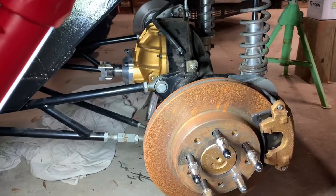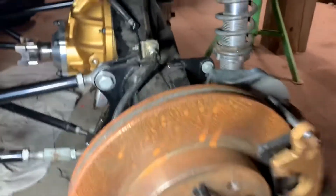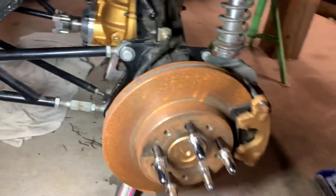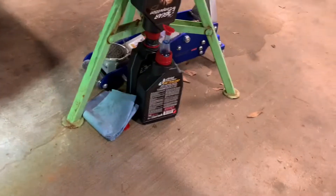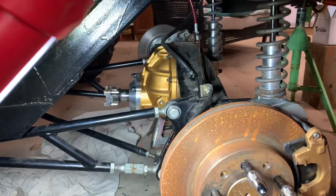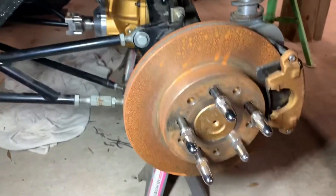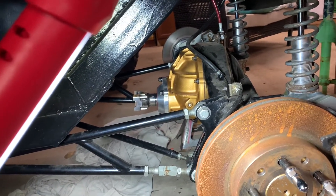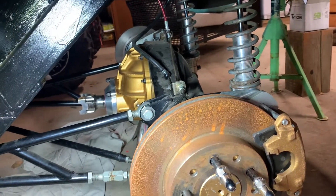Let's see what we got going on under here. As y'all can see, I got the nine-inch put together — axles in it, third member in it, no drive shaft. Hopefully tomorrow I'll get that slapped in. Already filled the axle. It's got 4.56 gears — technically 4.57 if you round it. The rear end has a Wavetrac locker, 35-spline Moser axles, nodular iron performance case, aluminum Daytona pinion support, and a chrome-moly 1350 yoke with a set of pro gears.